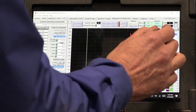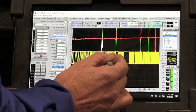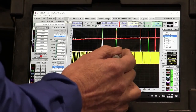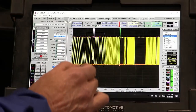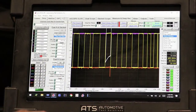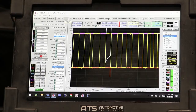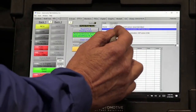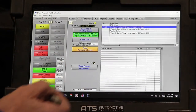Again, we can go back out. We can see where that all happened. We can see that this fired and then it got stuck high. Then we got it again. And this is just knocking the ICs out in the crank sensor to where it can no longer pull to ground. That's all that's going on here. And again, you can see how big that hit is. IC circuits, silicon just doesn't like spikes like this occurring. So that definitely shows that that spike is what's setting this DTC, and this DTC is what we're trying to fix. It's what they've been trying to fix for months.